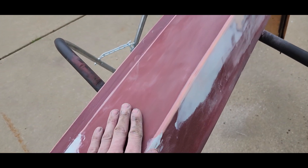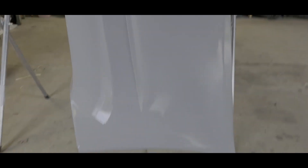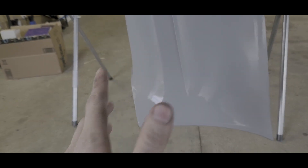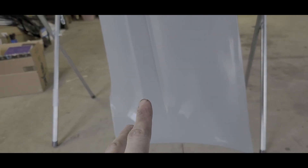There goes the air compressor — we'll see what happens. Sorry guys, I'm doing a terrible job of filming tonight. So it begins — I got one coat on. I 320'd the whole thing and then went over with a red scuff pad, scuffed the whole thing. This primer acts a bit different than the stuff we use at work.